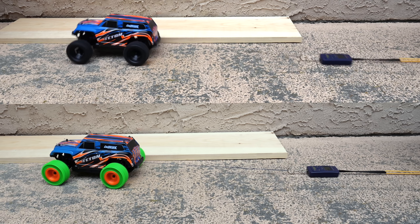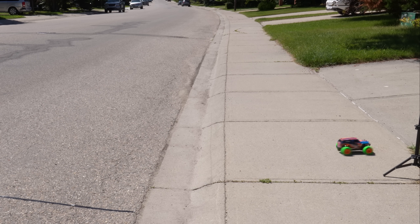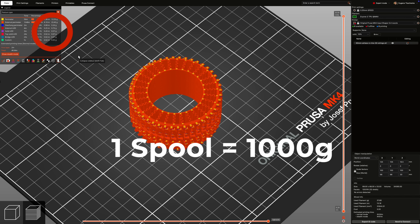When I started working on the tires, I wanted to say they are the best. Now, I don't want to lie — they are not better than the stock rubber ones. They don't expand at high speeds, but they definitely have less grip, and acceleration and handling take a hit. That said, they serve a different purpose. They are super affordable — you could print hundreds of them for the cost of a single Traxxas tire kit. So if you're a pro racer, invest in top tires. But if you're into drifting, training, experimenting, or just want to have fun without breaking the bank, feel free to download the 3D printable tires. Links in the description. Cheers!